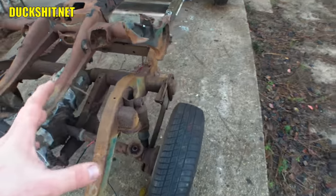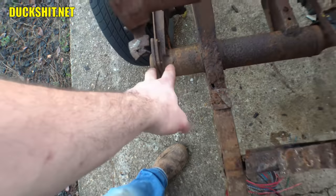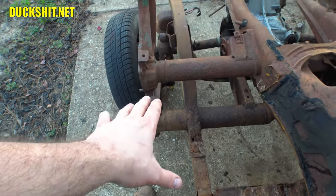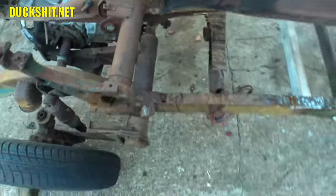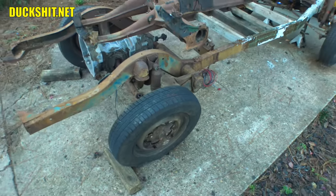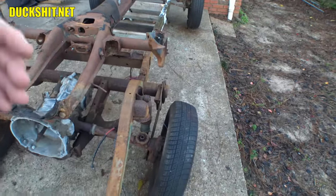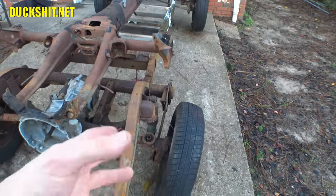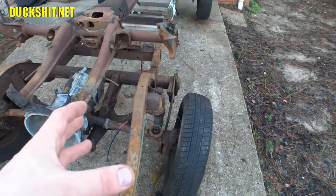When I narrowed the bus chassis on Gregory and cut this torsion tube out, I took out roughly an inch and a half, which might have been a little more than what I needed — an inch and a quarter probably would have been the best method. But nonetheless, that width worked when I converted it to IRS, because an IRS suspension just happens to be wider than a swing axle. So it moved my wheels around, and that's why that system works over on Gregory.